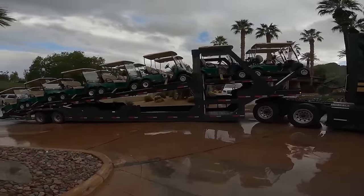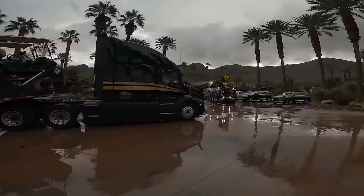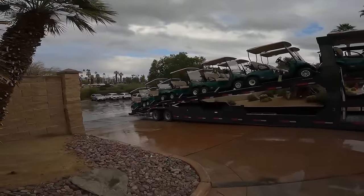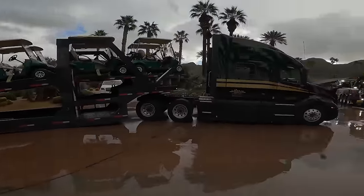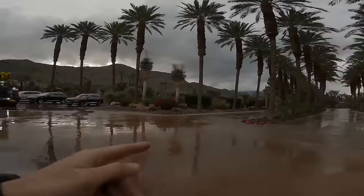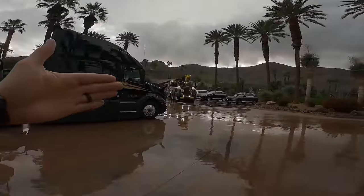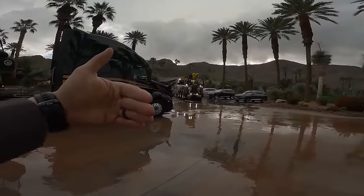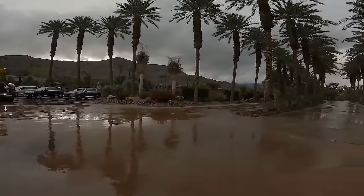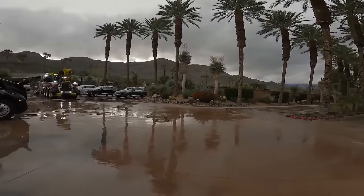Being that he is as lightly loaded as he is — obviously he's loaded but just with golf carts — I'm electing to just pull him straight through rather than back down because there's really nowhere for him to turn around down there. He also needs to go out that driveway, but due to the angles we're working with, if I put the rotator there the whole front end of this truck is basically going to jackknife before we start putting pressure on that trailer. So if we do that I believe he will no longer have the proper angle to make this turn and then we're going to have another set of problems.